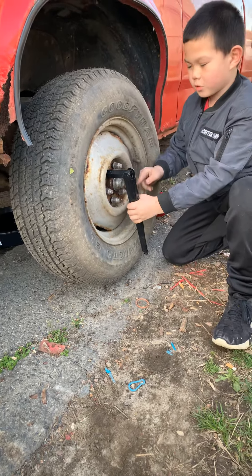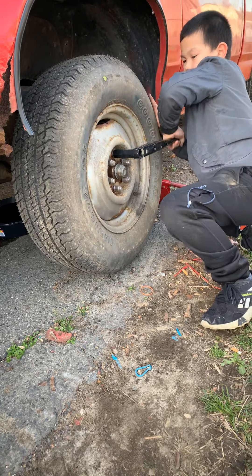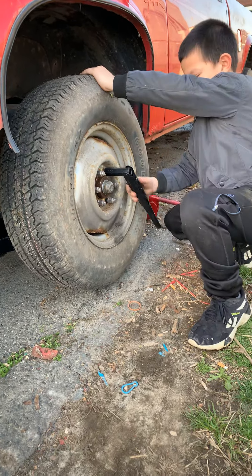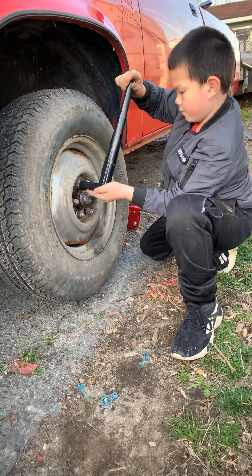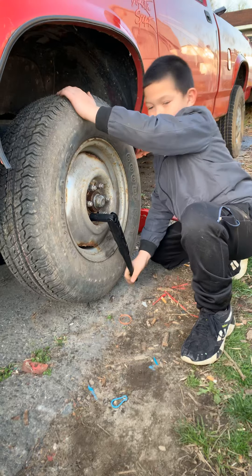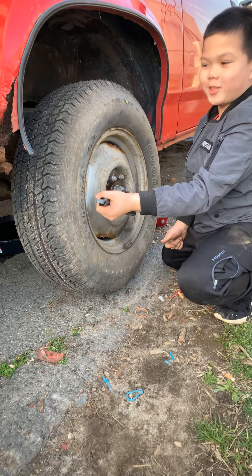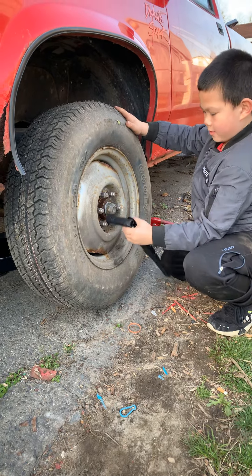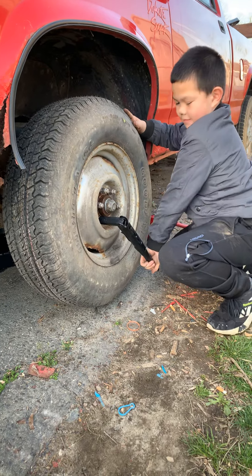You have to make sure you get the bolts tight so that when you're driving your truck, the front wheel does not break loose. Now go ahead and pull that off — go down to the next one. I'll show you how to tighten them up. Don't go to that one — go directly across. You clamp from one area and you move out diagonally to keep the surfaces flat and tight together instead of creating a wobble.